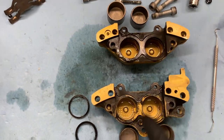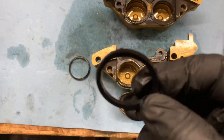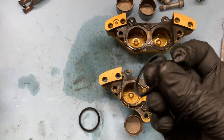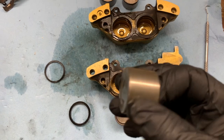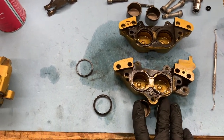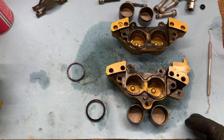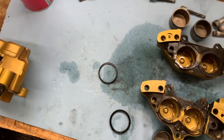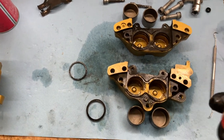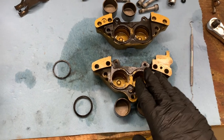Take these two halves and give them a nice scrub. Get the piston cups cleaned up. Looking at the O-rings, I don't see any nicks or damage to either one — they look really good. The piston cups: no scoring, no scratching, nothing else — they all look really good. I don't think we need to replace anything. A full rebuild kit is about $100 per caliper; even just the O-ring kits are $60 from Brake Crafters. The Brake Crafters kit comes with assembly lube, which I'll put back on these O-rings when reinstalling — it helps with installation and adds an extra layer to get a good seal and pressure underneath those pistons.